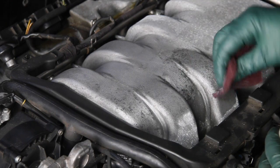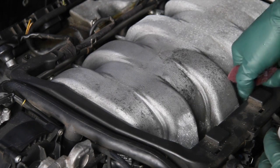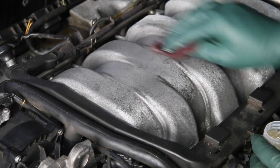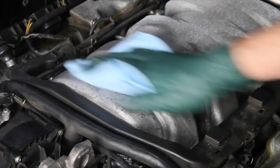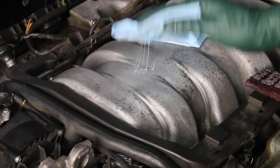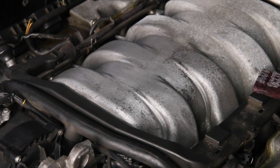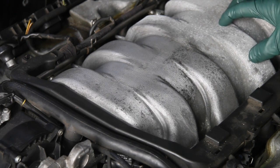You're going to have to decide how far you want to go on this. If you wanted to make this perfect, you'd probably have to pull this wiring harness off, but I'm not going to do that. I'll get an acid brush and just get some of this gel and work down in the cracks to prevent corrosion. When I'm all done with this, I'll wipe it down, get all that excess metal powder off, then put a light coat of the gel on with a rag and not rub it completely off. Now I'm going to move to the back section and try the metal wax to see how it attacks the corrosion.